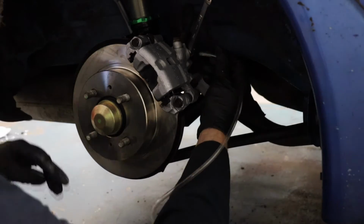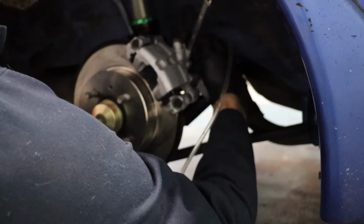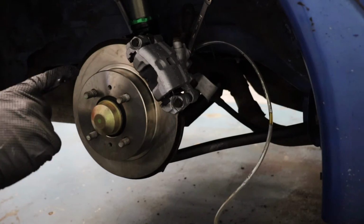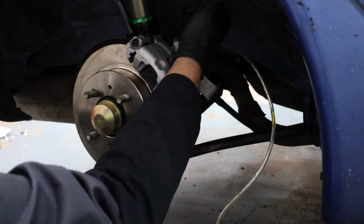Go ahead and squeeze our hose over, and you want that to be a super tight fit. You don't want air to get under there. And then once you have everything hooked up, you can crack open that bleeder valve and you're gonna see the old fluid come down the hose and go into this. Let's see what happens.